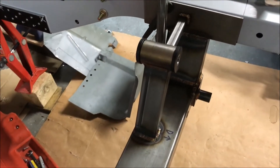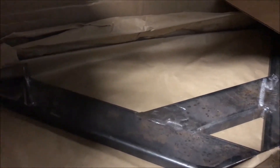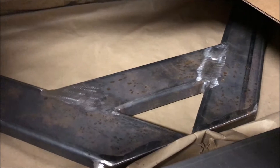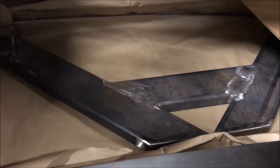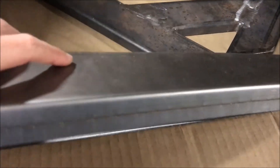There's no way I'm going to compete with this gorgeous stack of dimes from Rod and Custom — so far I'm very satisfied, their craftsmanship is amazing, very well-made stuff. Not so much for the Mustang inner fender aprons: the jack pad is MIG welded, everything's ground down except for the tie-downs, and those MIG welds are not the best — rough, splattery, surface-rusted like crazy. Normally if they're storing them you'd think they'd coat them with oil or anti-rust primer.